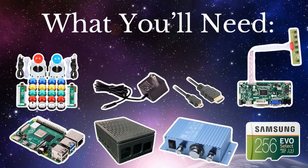What you're going to need to get started is a Raspberry Pi 4 with at least 4GB RAM, a Raspberry Pi 4 cooling fan case, an SD card with RetroPie and your game collection on it, a Raspberry Pi power supply cable, a Type-D micro HDMI to HDMI cable, an LCD controller board with settings button board, a two-channel audio amplifier, and an arcade button and joystick kit if you plan to upgrade your arcade buttons and joysticks.